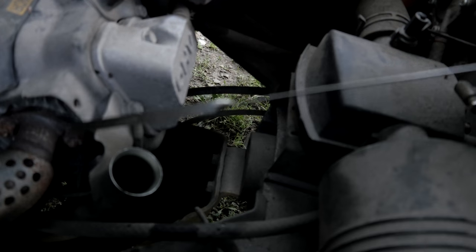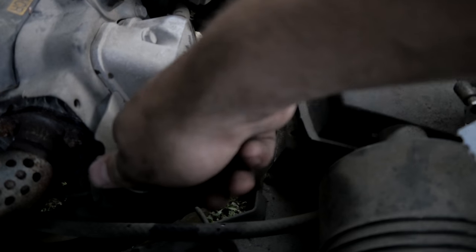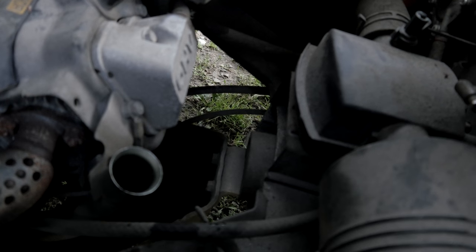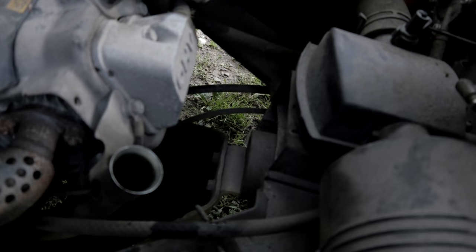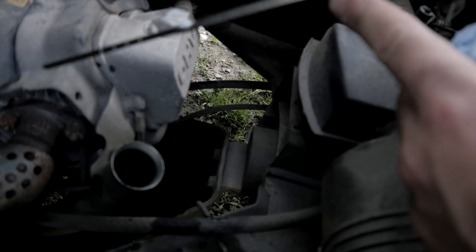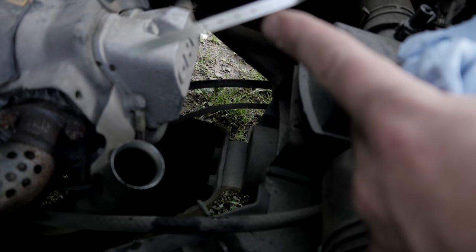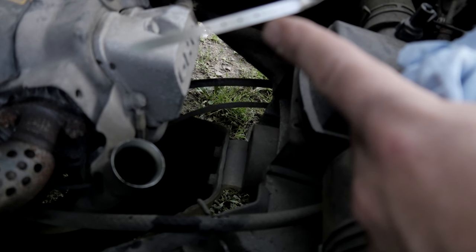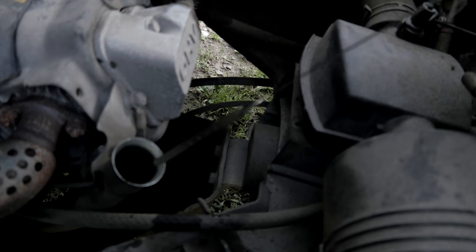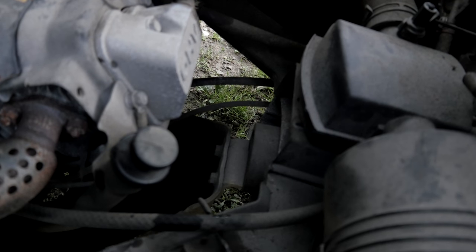Here's our dipstick - you can see we have gasoline in the oil. The oil is actually not in bad shape, but it's all the way up to the middle of the dipstick. It's only supposed to be to the fourth line or dot circle hole. We have to change the oil and filter, change the fuel filter, and remove the carburetor to clean and reinstall it.